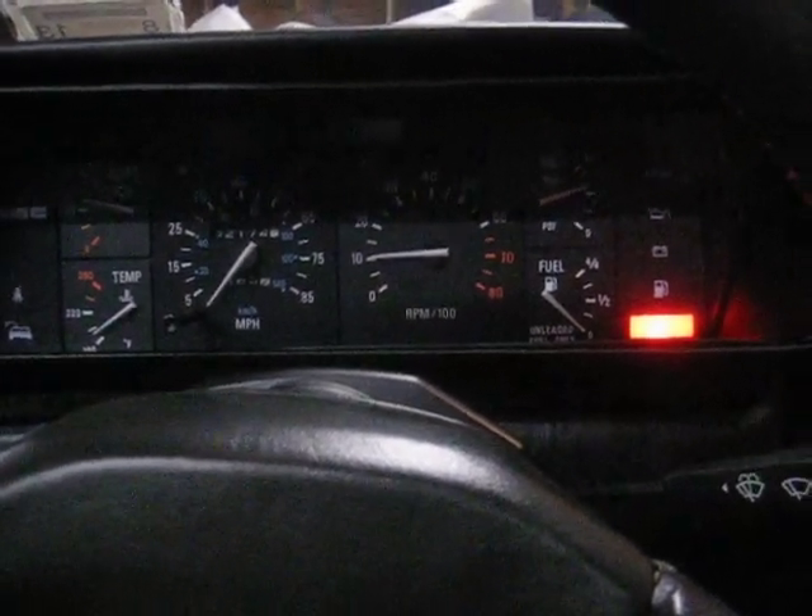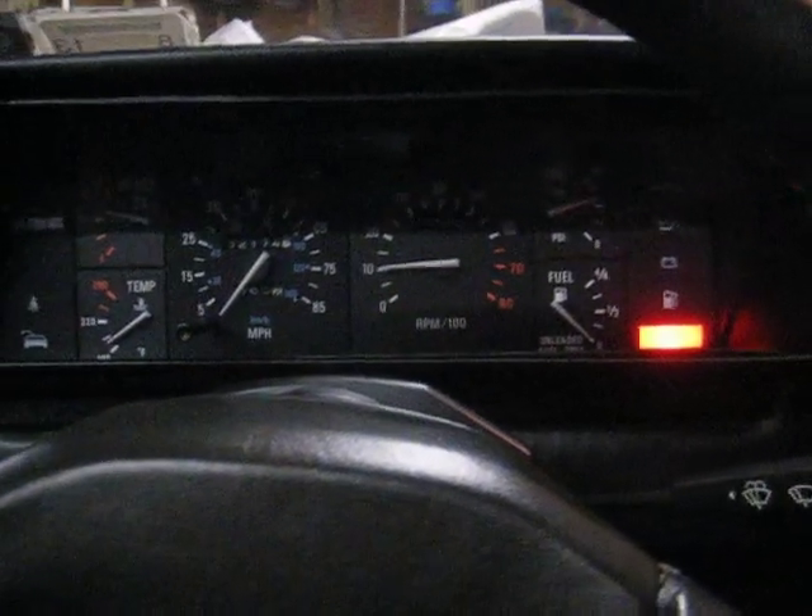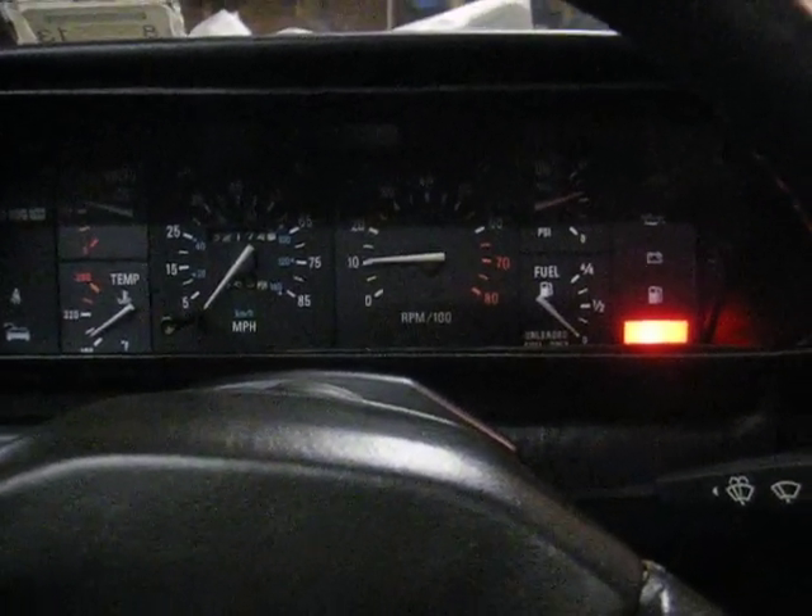It's been warming up a little bit now. You can see how nice and smoothly it idles at about 1,000 RPM. There's my wideband showing a nearly stoichiometric idle. I run it a little bit richer because that's what the car seems to like.